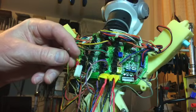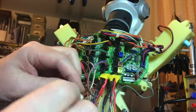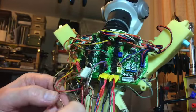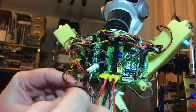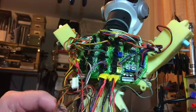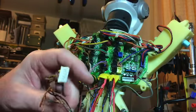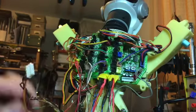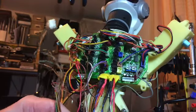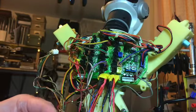Now what I need to do is to actually trace this all the way down. I'm not going to attempt to take any more off, because if you do, you'll end in disaster. So just pull this through the entire wiring loom, which is a bit tricky. Seems it's so crooked and sharp in places. And I'm going to follow this all the way down. As you can see, I'm being really slow and gentle with this, because what you don't want to do is to damage any of the other wires. Yeah, I know they're damaged already, but you don't want to snap any of the wires, because it'll just cause you problems in the future, and also you don't want to damage that end.